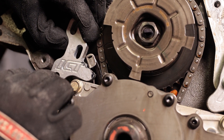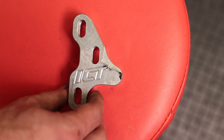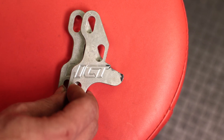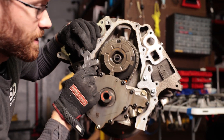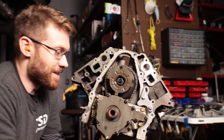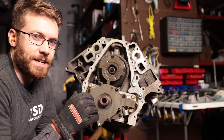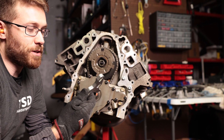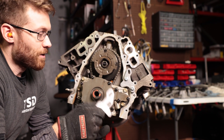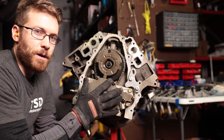As you can see, you can get this to work — save yourself about $80 and pick this up on Amazon; we'll have it linked in the description. You can get it to work and that is what I wanted to prove in this video. Now as I said, you don't have to use alignment tools — we did do it without. However, you are definitely taking a chance if you don't use the alignment tool. Now that we know we can get one for $40, with all the money it costs to delete the DoD you definitely don't want to skip having your oil pump aligned.